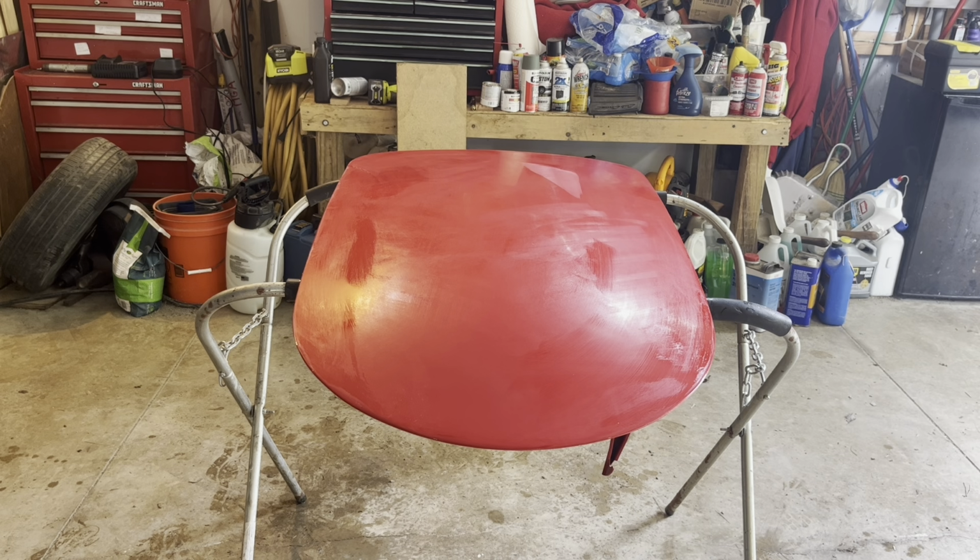If you're doing a show car finish, you would step it down more progressively and go beyond 1500 grit. But it also depends partly on what you have for rubbing compound and your buffing pads. I use a waffled pad, which does a better job, and I don't have to go down to like 2000 grit or finer, because those pads work really well. And I use a good professional quality rubbing compound as well, which is quite expensive, about 60, 70 bucks a quart.